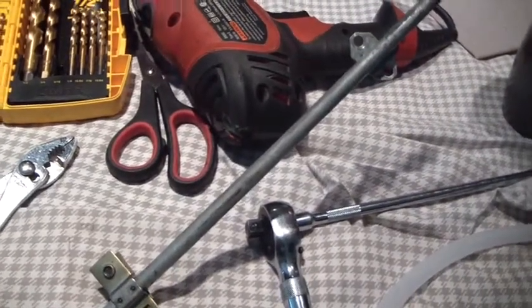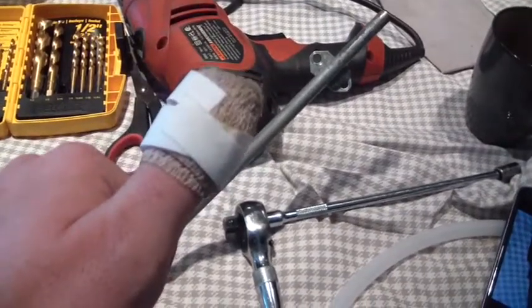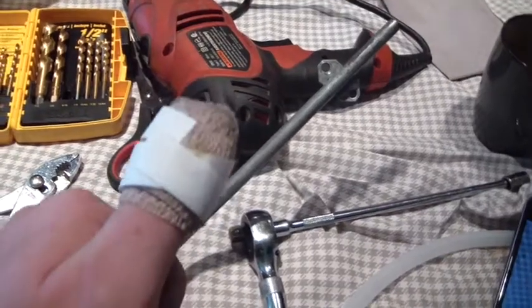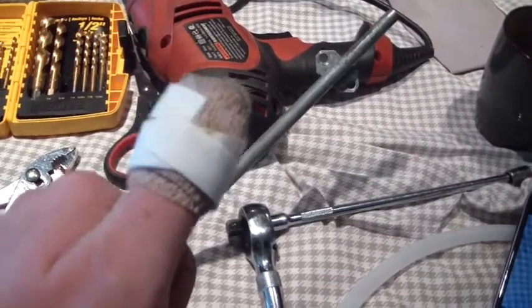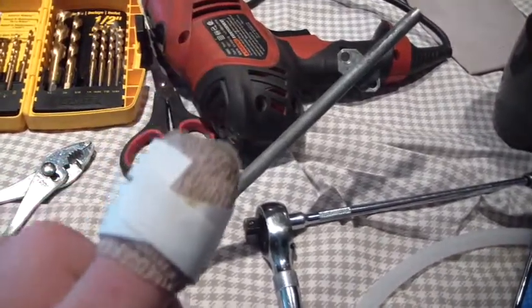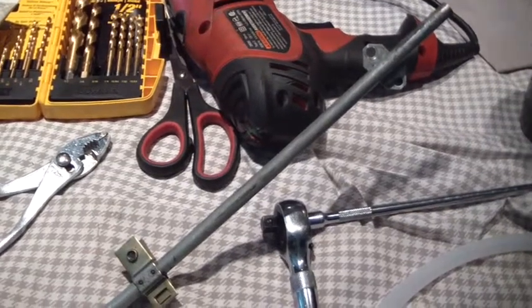And a safety tip: they talk about taping the inside of your door panel. That's no joke. Do it. Even though I taped some areas when I was trying to put the window back on track, it's razor sharp, and I still cut myself. Definitely make sure that you wear some gloves or tape up those areas inside the door panel.